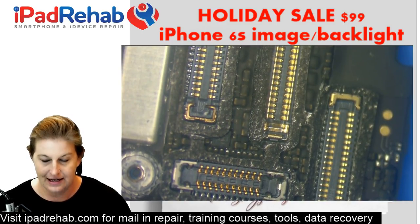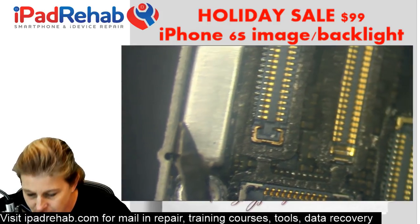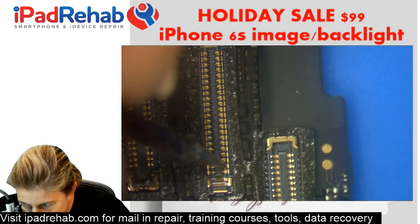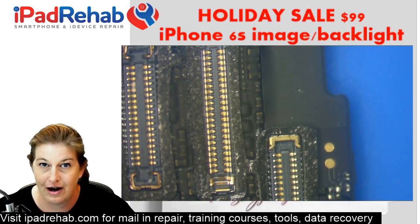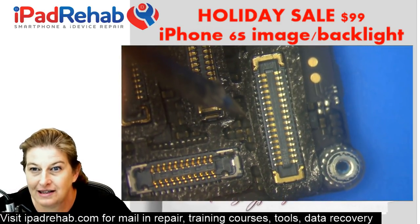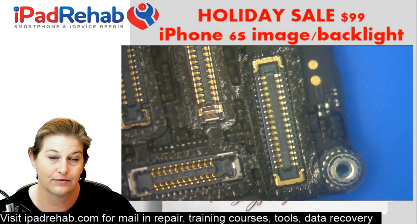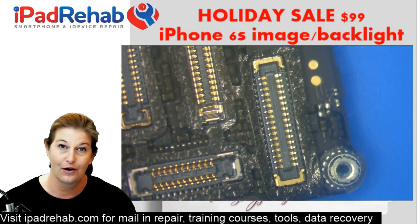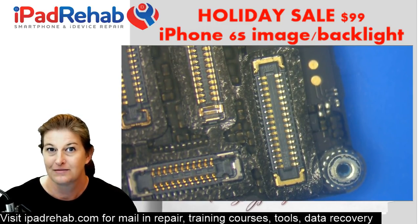The first thing I'm going to do is check for a short to ground on the backlight anode line. I put my multimeter in diode mode, red probe on ground, then go to the backlight anode line pin and get a reading — 0.525. That is normal. That tells me there's not a short to ground, and it also tells me the backlight filter is good. If the backlight filter is blown, I'd get an open line with a really high diode mode reading.